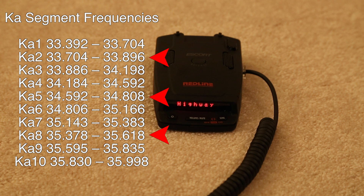Segments 2, 5, and 8 are designed for 33.8, 34.7, and 35.5 — guns that are in spec, calibrated and certified, and legal to issue tickets. Guns do drift over time and can actually drift in frequency beyond where they're supposed to be — outside the range where they're certified to transmit. If this happens and those guns are being used to issue tickets, you can get clocked by one of them, and your detector will not alert if you have it segmented as 2, 5, and 8.